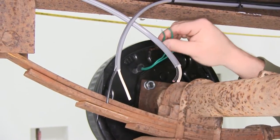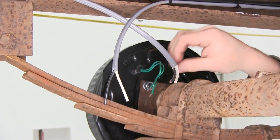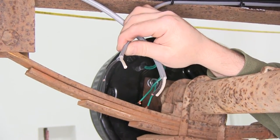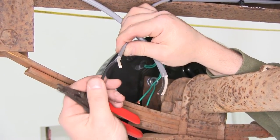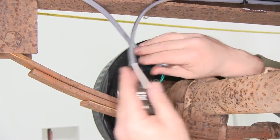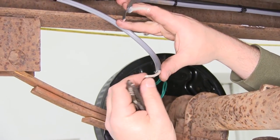Now let's go ahead and point out our wiring. You'll notice that there are two wires that come out of the back side of the brake assembly. We'll need to connect our wires that come from the front of the trailer. In this trailer, the black wire is the positive wire or the brake signal wire and the white wire is the ground. There's also another wire that runs over to the passenger side, so we'll need to tie this in when we make our connections.